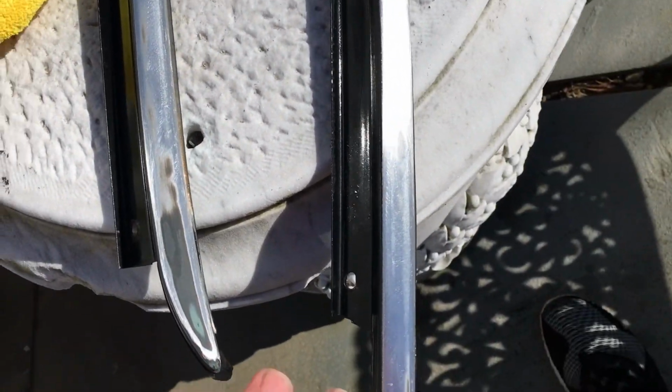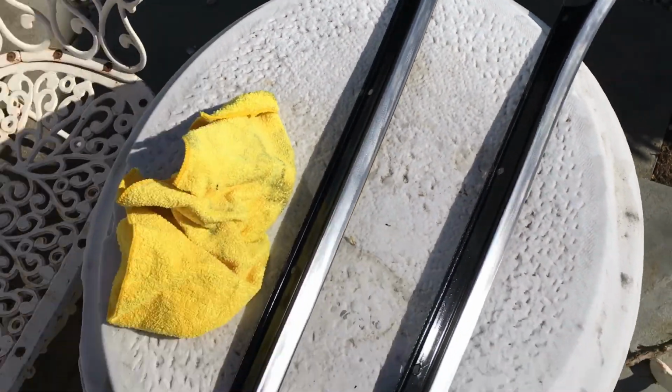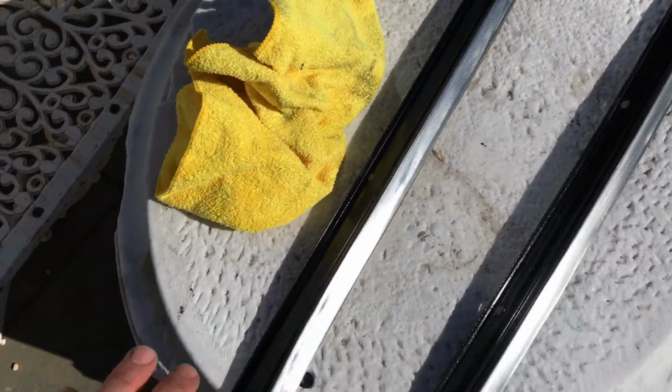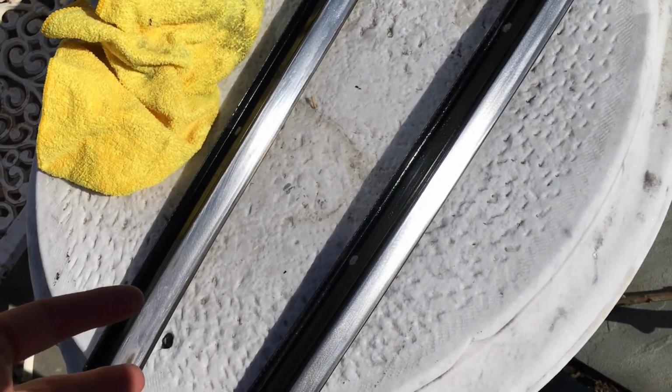Okay, just finished sanding up. I just made it as smooth as possible with the finest grit, instead of getting rid of all the base paint. So it's all sanded up and smooth right now. Just rinsed it off, both sides, with soap and stuff, to make it a clean surface, and now it's dry and clean. I just need to get primer. I think primer is good because it'll fill in all the little sand crevices and all the cracks and whatever I missed because I couldn't see.